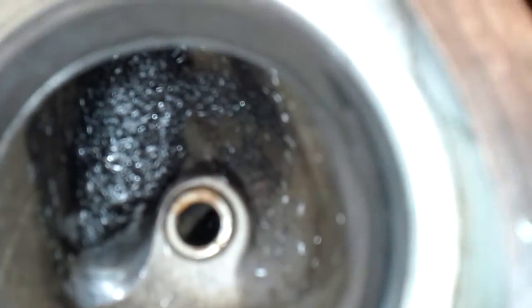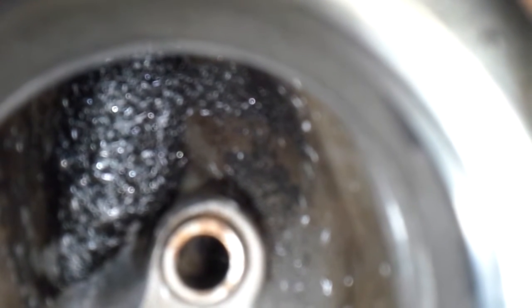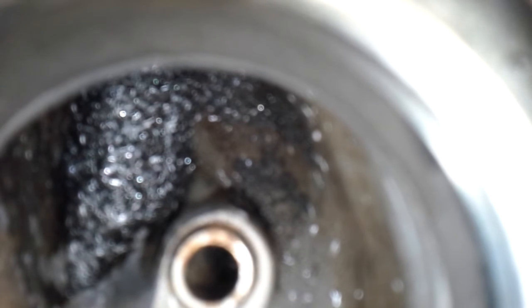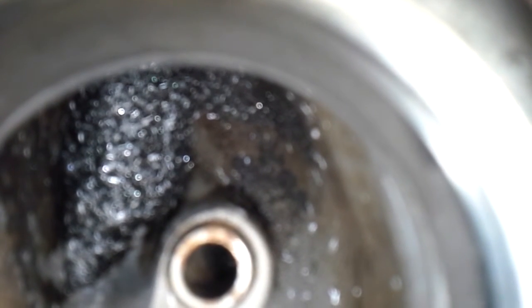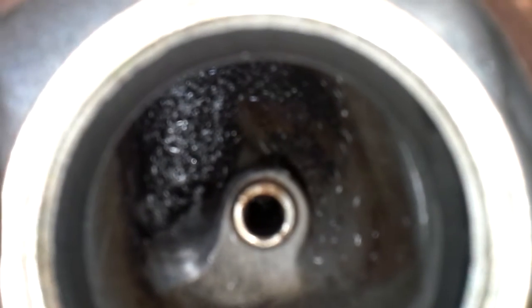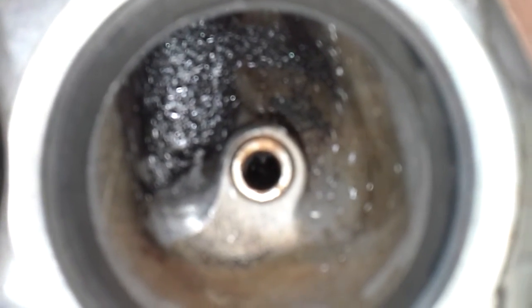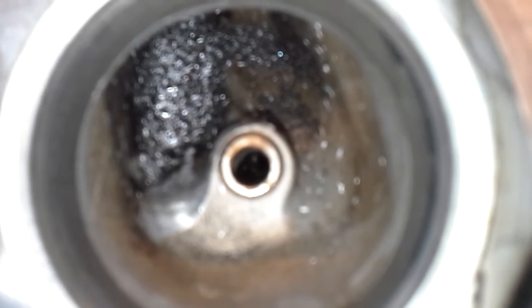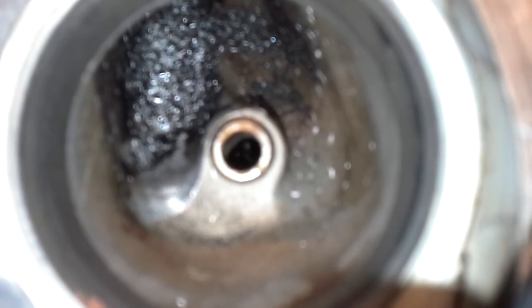If you look below the guide boss, you can see the little tail. They've done a really good job, because what they've done is put an airplane-like tail at the base of that guide boss that actually angles towards the center of the opening of the port on the intake side, and forces that air to go around that guide boss.